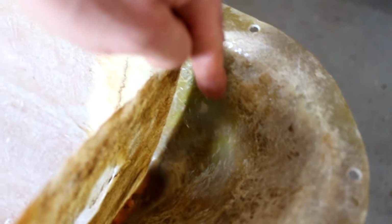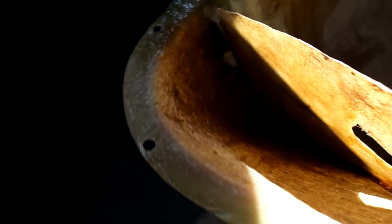And in these corners where I did the thickened epoxy, I need to lay up some of that. I think I'm going to use the 1808 through here and make sure that those repairs are solid on both sides. Then my new transom can go in.